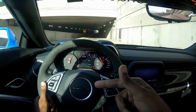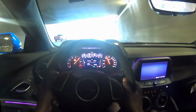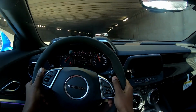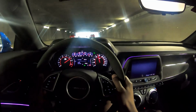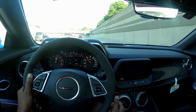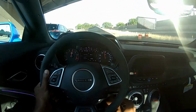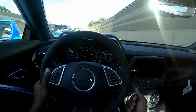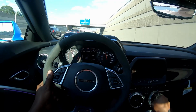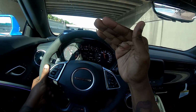It works better when you get on than just let off. But the secret to that is feathering it, like when you get on it. So when I say feather it, that's while the RPMs are going down, you want to put your foot on the accelerator slightly, not to where the RPMs increase, but on the decel that it just falls slower than it normally would.